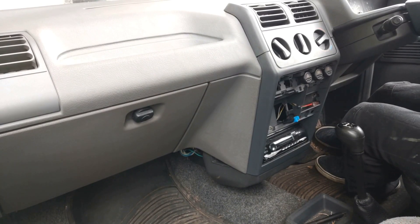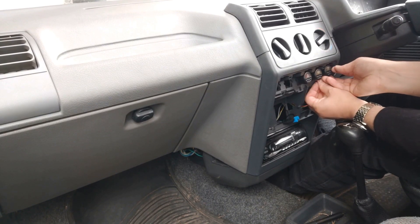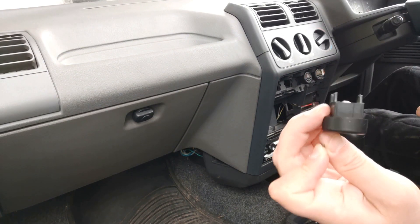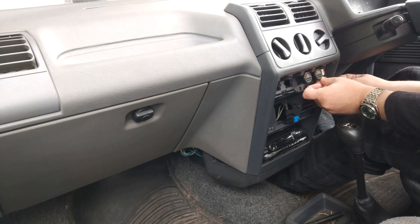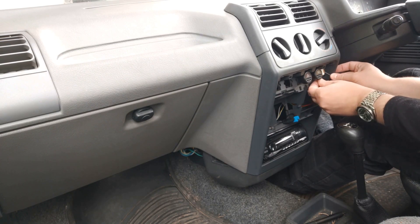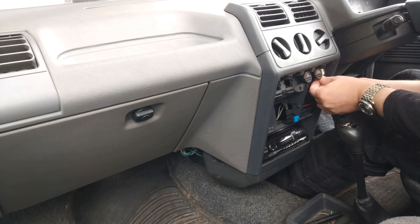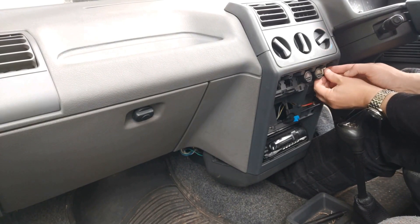So we've got back to the pins either side. The switch will just pop off first — just a bit of pressure to pull that off. This is just a release again, so I'm doing the same thing. I could find something a bit more useful like a trim tool but I don't have any to hand. You can see there are a couple of little slots either side of the plastic piece and I'm just going to slot these pins in — really, find something more useful than this because this is not the best tool for the job.